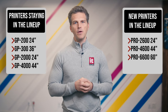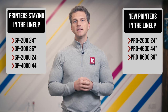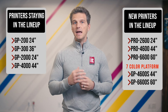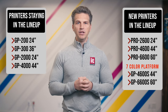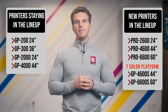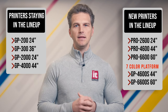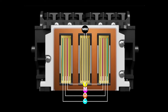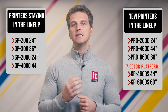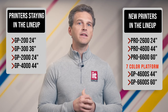Now finally we come to the biggest change to the Canon Pro and GP family lineup. No longer will Canon offer an eight color S version of their Pro Series printers. Canon will now address this productivity-minded customer base with a brand new seven color platform called the GP4600S and GP6600S. The new GPS printers will share the same body as the Pro Series but will no longer share the Pro badge. The new GPS seven ink printers will feature CMYK, gray, and orange inks. The new orange ink widens the color gamut to give posters and graphics more vivid color. Canon has used the same scratch resistant wax component found in the Pro Series to improve damage caused by abrasion and handling. The GPS series will use the same print head as the Pro and GP series, but its mirrored layout is designed to layer inks identically in bi-directional printing — a really cool innovation that delivers better control and consistency during high speed printing. For customers looking to produce eye catching graphics and posters at production speeds, the new GPS series will provide the most attractive option in the Pro and GP family.